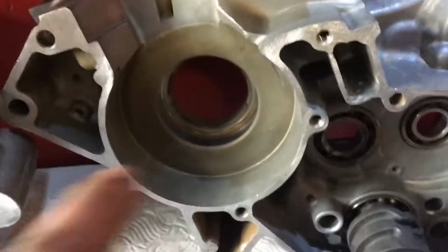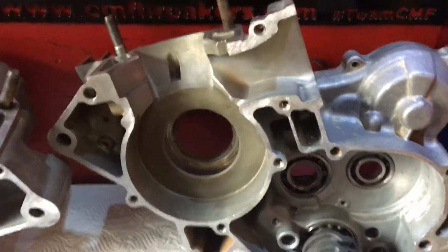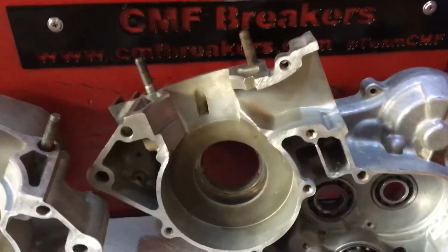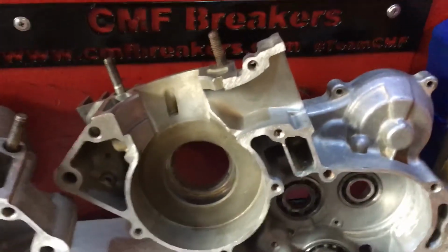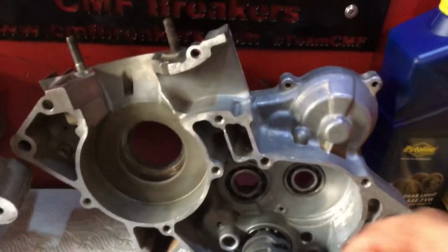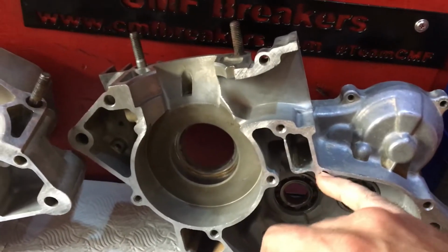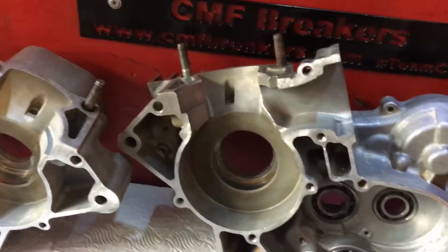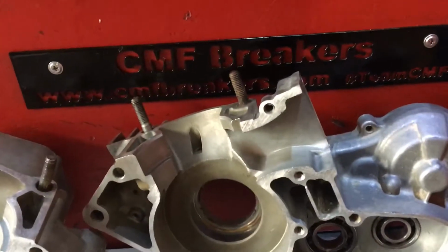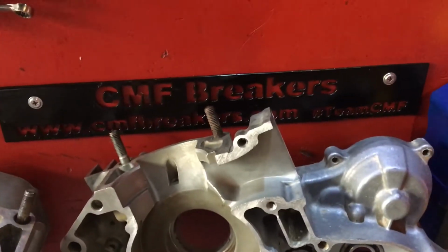Bearings, like I said, get your casings red hot. Now, if you've not got a blow lamp, you can put your casings in the oven. What I would suggest is putting them in a cold oven and then warming them up gradually. If you put a crankcase in an oven that's red hot preheated, there's a possible chance you'll heat these parts up first and crack them. Little thin parts. I'm not saying you will, but you could damage them. What you need to do is put them in an oven that's cold and gradually build the temperature up so it warms the whole case at the same time.